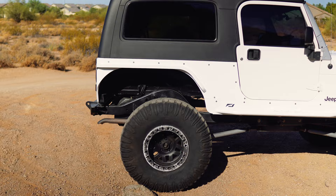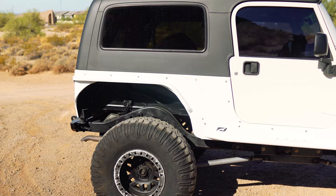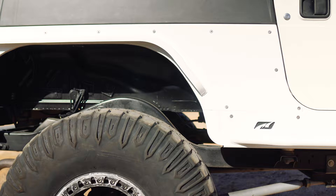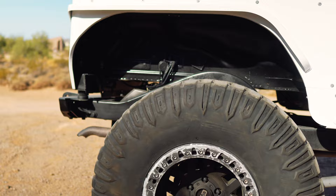Right back in this area, that tire and axle needs to be moved back — which is what we're going to help him with. Brad already did the comp cut from Motobilt; he did a good job in his garage cutting it up and rolling the corners. It looks really clean. Now it's up to us to stretch this axle back with a combination of a different fuel cell, aluminum links to lengthen it, trusses from Motobilt, some bracketry, and coilovers from ADS.